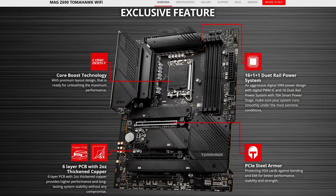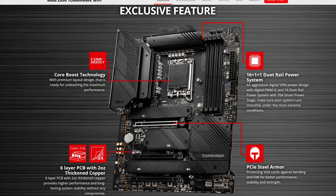However, what most companies do is just put another physical x16 slot right there in the middle for compatibility, and there's clearly enough space for it here. So it really just depends on what you need — there will be people who wish there was an x16 slot for compatibility, and others who'd appreciate that their 4X cards finally have a home. Add to that the fact that this board also has 4 M.2 slots, with 3 of them having heatsinks, and when it comes to PCIe expansion, you're all good to go.